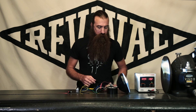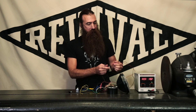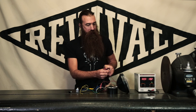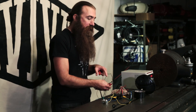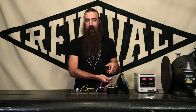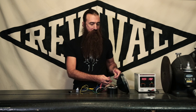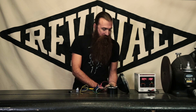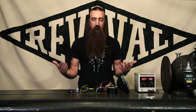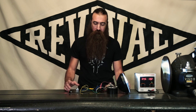They're relatively impervious to reverse polarity, as I'll just demonstrate right now. I'll disconnect these and connect them deliberately backwards — black to red and red to black. And it doesn't like that at all. It's going to honk the horn so it can dissipate some of the power and let you know that you are not doing it right. So if your horn starts to go off as soon as you connect your battery, it's probably because you're connecting it reverse polarity. It doesn't mind being connected with reverse polarity, and it's got built-in circuit protection that will shut down all the outputs and inputs if there's too much current flowing through them. But what happens if you end up with too much voltage? That's the one thing that really can effectively kill the M-Unit.